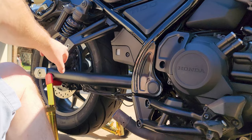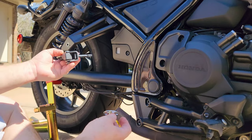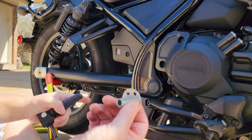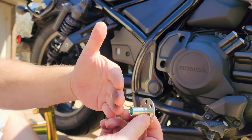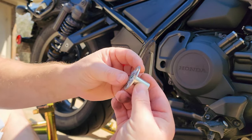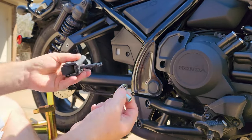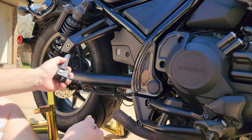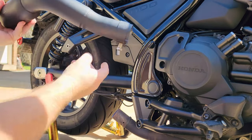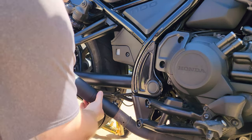I almost forgot to show what I'm doing. You just pull the original foot peg bracket out of there. If your bike isn't equipped with passenger pegs, you don't have this anyway. The OEM exhaust had a spacer in there — two collars butted up against each other and rubber dampers and all that. I just disassembled that damper assembly and I'm using it as a spacer off of the long passenger peg to take up that slap. So pull this thing loose and get the exhaust situated, then put this all back together once it's in there. I've got my clamp situated so the bolt is going to be facing down inside — that gives a nice clean finish on the outward side of the bike.